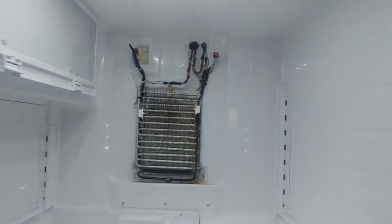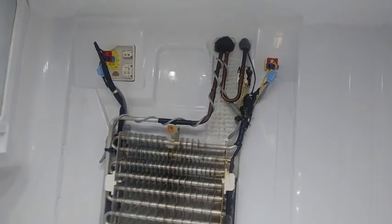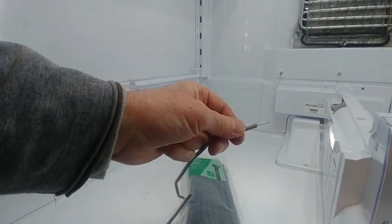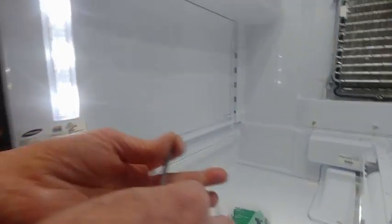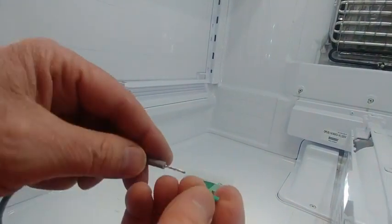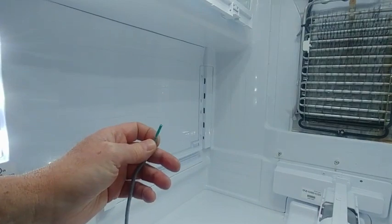One other thing: when you buy these wire tap connectors, you need the ones that say 18-gauge to 14-gauge. I found that these wires are really, really fat — the insulation is really thick and they won't actually go into the little connector because I measured it to be about 17 gauge. So what I did is I took a standard house wire or speaker wire, extracted a little piece of the plastic from it, trimmed it right to the end, and inserted that into the connector. That centers the wire, and when you crush down on the crimp it'll nail it dead center.